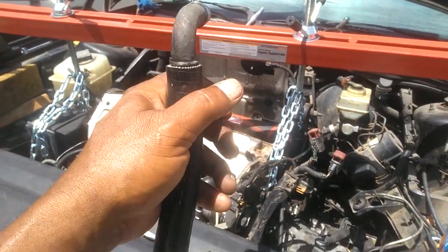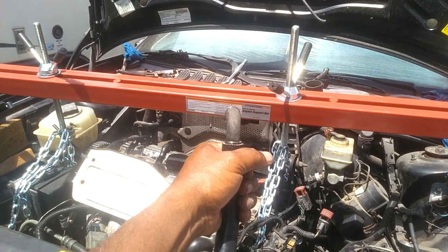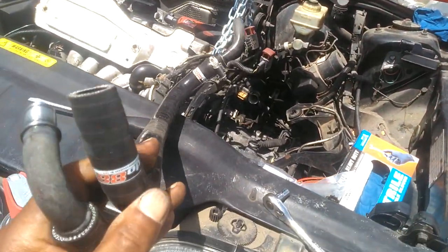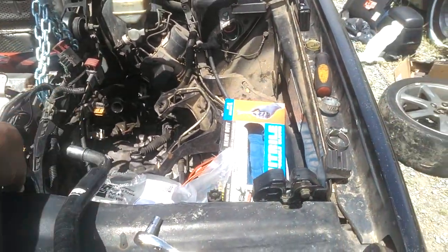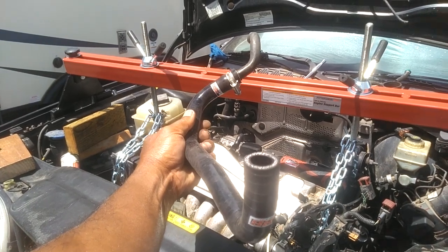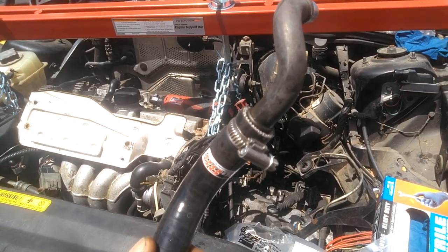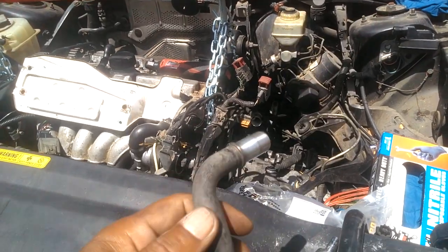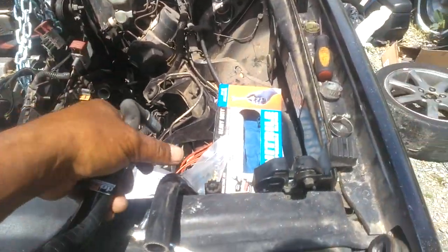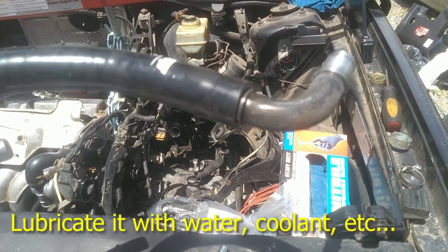The orientation of these ends is important because you don't want them stressed — you want them to fall natural. If you hold that straight away from you, it'll almost point exactly away from this opening. On this one it's kind of the same thing: you want the end to point away from the hose connection. That should be the proper orientation. Then when you put those on, put them on tight enough so you know they won't pop off. I always lubricate the piece that I'm pushing on — it goes on easier, then I clamp it and it shouldn't leak.